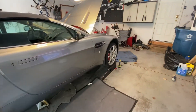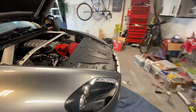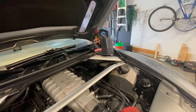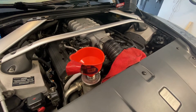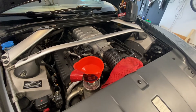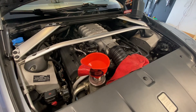I've just put in 9 litres — the best part of two of these 5 litre oil jugs. I'm going to run the car a little bit, check underneath to make sure there are no leaks, and then check the dipstick level. I'll need to top up a little more since the capacity is 9.5 litres, but I just want to make sure I don't overdo it first. And that should be it — oil change done.